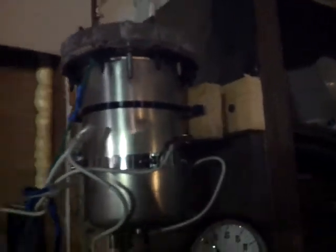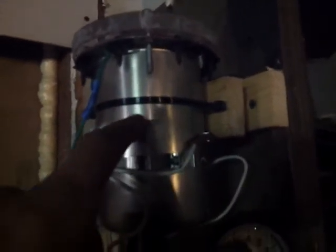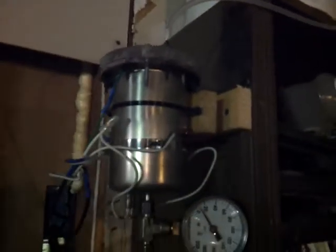One more thing: this heating element from a one-cup coffee maker came with a cheap thin plastic top that looked nice, but when I subjected it to the full pressure of the municipal water supply — about 60 PSI — it burst immediately. So I had to make this plate, which is made of either three-eighths or half-inch clear plexiglass, and fashion a nipple at the top for the hot water output.